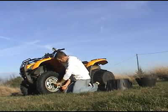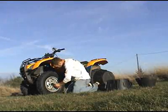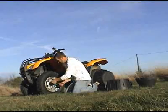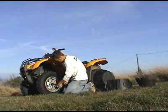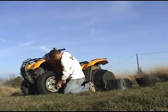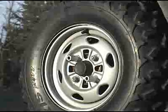On your ATV, begin by removing one of your vehicle's lug nuts and replacing it with one of the included coupler nuts in your kit. Next, remove the opposite lug nut in the pattern and replace it with another one of the included coupler nuts. Tighten both coupler nuts to your vehicle's specification for lug nuts. When you've finished installing the coupler nuts, it should look like this.